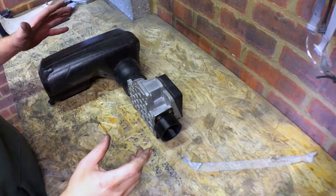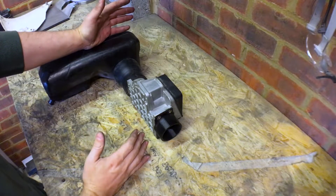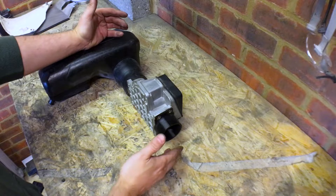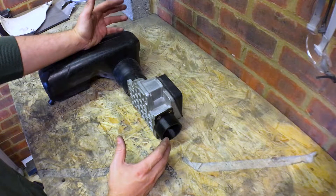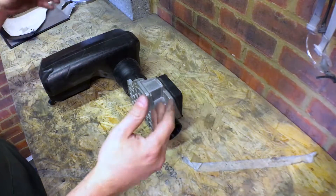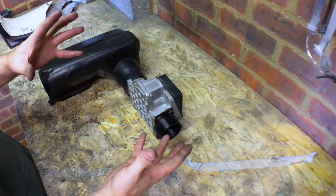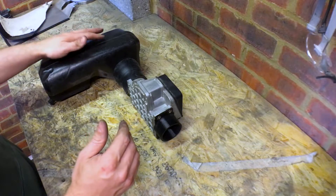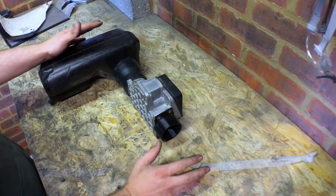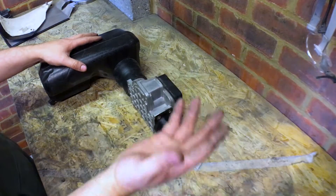So this is the assembly. Just had a quick look at that fan — that cap can't go anywhere, it has to be there. It can't be shortened at all, so that's the limitation with the room. I've been watching and I've seen people put in SPAL fans — they do a slimline fan. Obviously those fans are quite bulky because the technology wasn't there back in the 80s. Fan technology is a lot better now, but those fans are known to be problematic anyway. So it would be a good idea to strip the fan away and have a decent fan — it's one less issue.